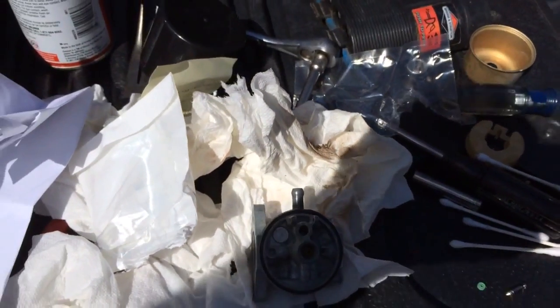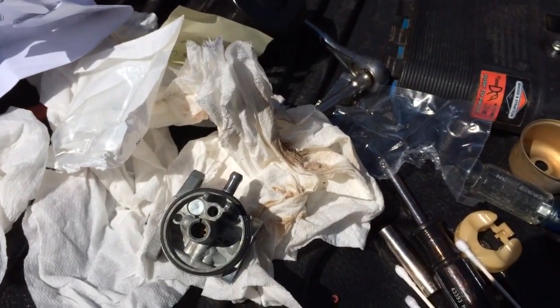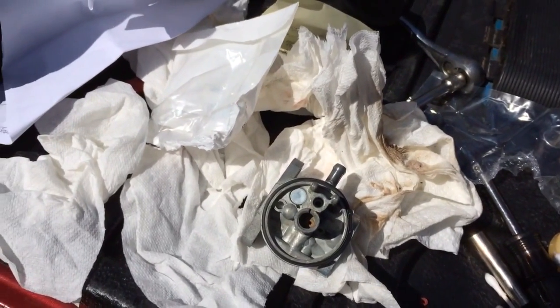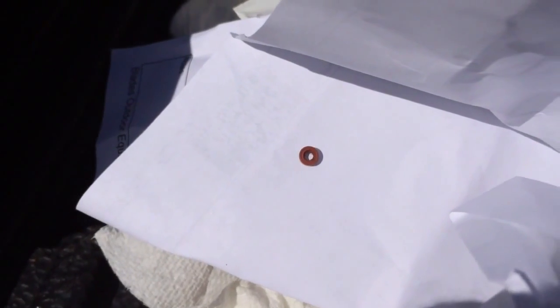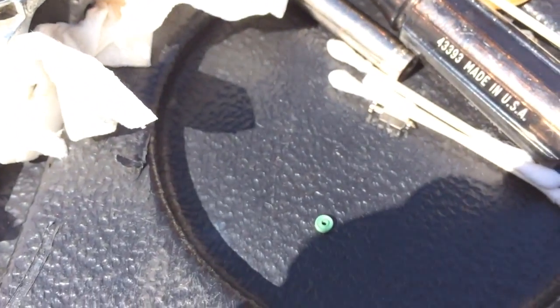What a lot of people tell you to do is get a rebuild kit. A rebuild kit will run you anywhere from $10 to $15 depending on where you get it from, and of course, it includes all sorts of gaskets and stuff. The main problem with these, and I've never seen this before in any other engine, is this uses a rubber O-ring type valve seat for the needle and seat for your fuel shut off inside your float bowl. With the ethanol and everything, over time the valve or the seat becomes deteriorated and allows the float to leak, or the fuel to leak.